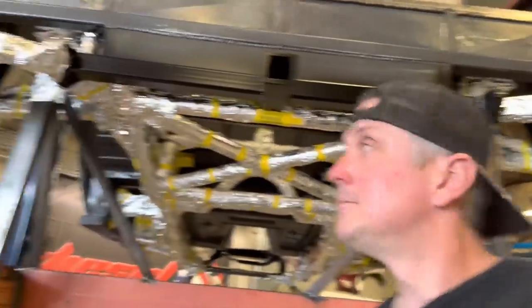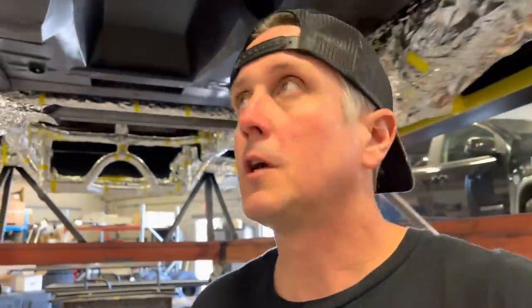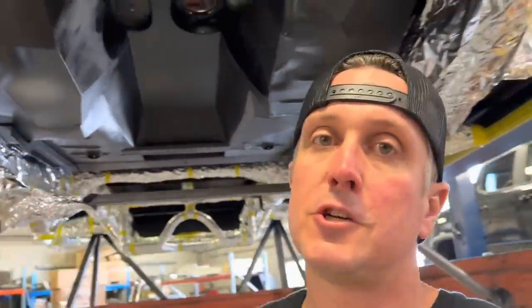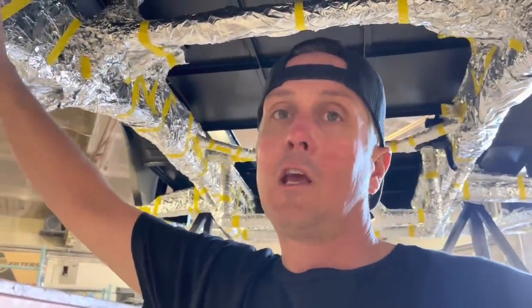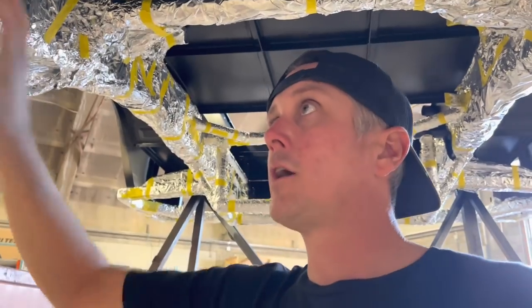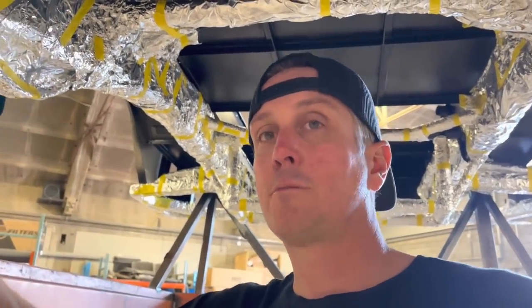You can see it right behind me — it's not really a big secret. It's tinfoil! This is one of my favorite tricks when you're doing a roll cage. A lot of times you build a cage in your Jeep or truck, paint the roll cage, and can't figure out how to avoid overspraying the rest of the cab. So this is the trick — putting tinfoil on the A-pillars or on the body so you can paint your roll cage and not get overspray on the truck itself.